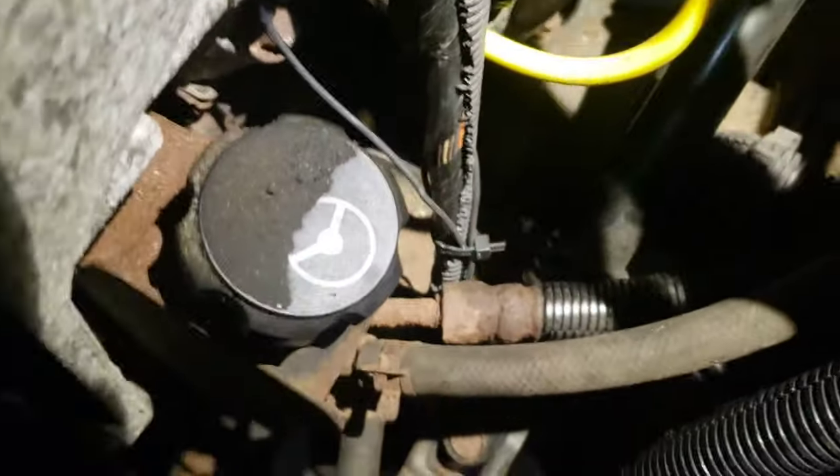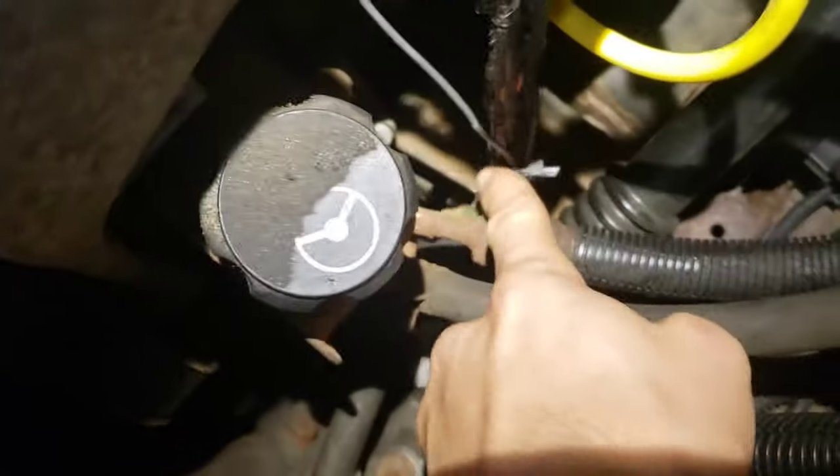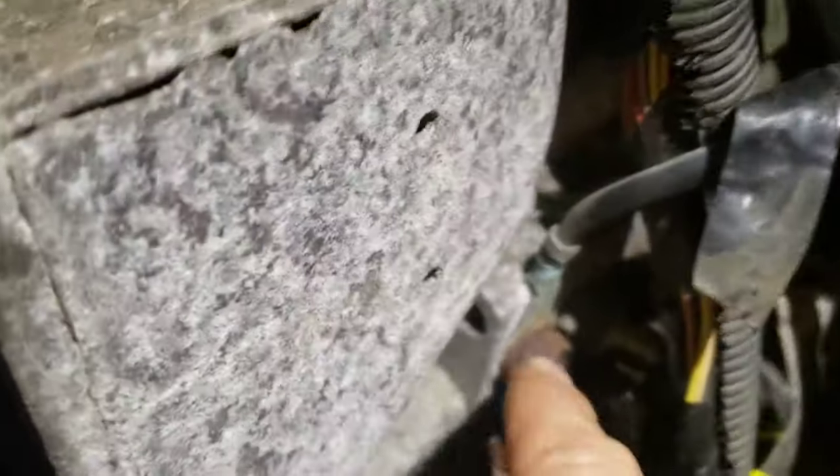I did a little hunting, traced around, and down behind the power steering pump - you can hardly get to it - but sure enough I found the ground wires for both of those banks. They were about ready to fall off, completely corroded. I ended up putting a connector on them - they used to just go down and eyelet out to the engine - and I moved them right up to this ground port which feeds the battery. No more ground issues.